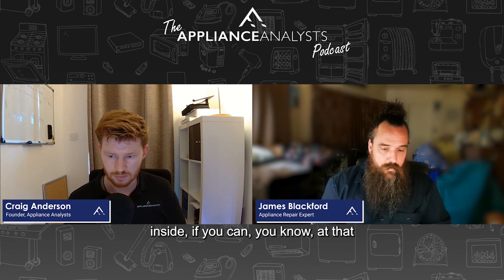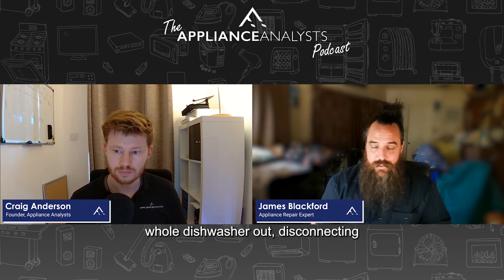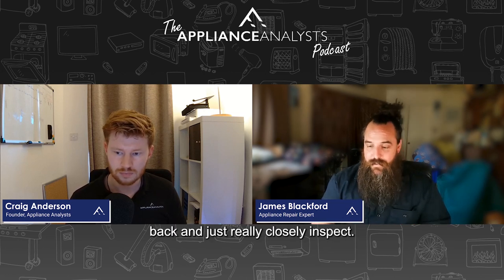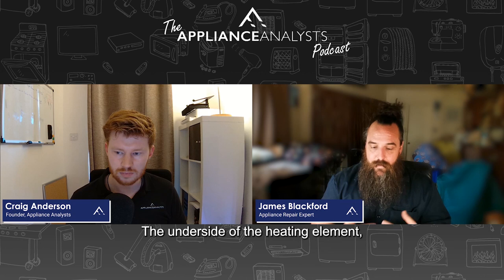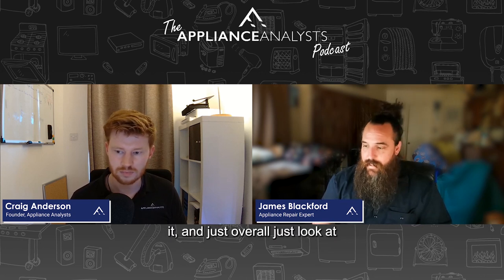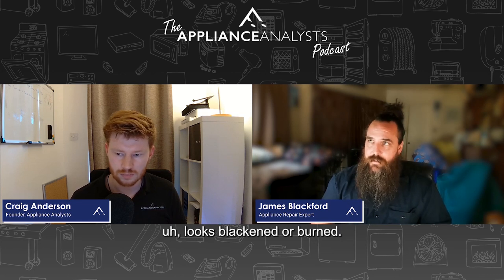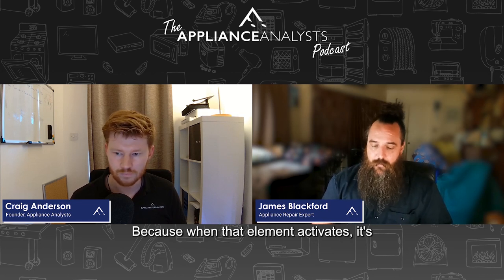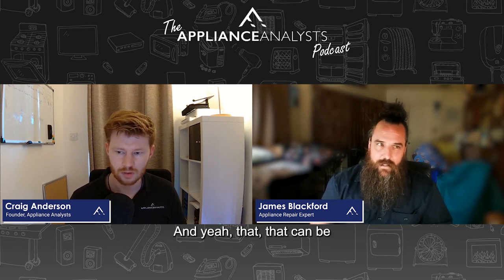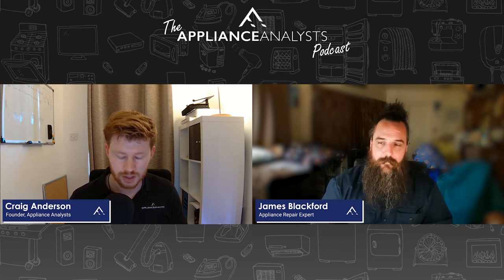If it's tripping the breaker, I would recommend pulling the whole dishwasher out, disconnecting it, and laying it on its back to closely inspect the underside of the heating element, the wires that are connected to it, and just overall all the wires, to see if something looks blackened or burned, because when that element activates, it's probably when it's tripping the breaker. That can be a little more difficult, but that's the most likely scenario. Gotcha, that makes sense.